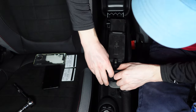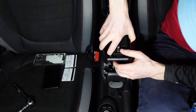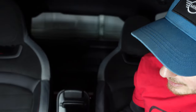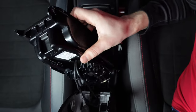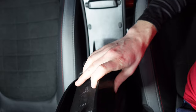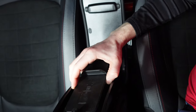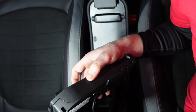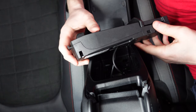Our four Torx bolts are out. Now the lining comes out and that gives us more access to unplug the cable. We've got the wireless charging deck and tray loosened up, which lets us cut the two cable ties at the bottom and move those cables more freely. The cables were routed through cable channels and zip tied tightly to the tray, but now that those cable ties are clipped we have much more access to the charging deck.